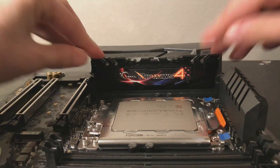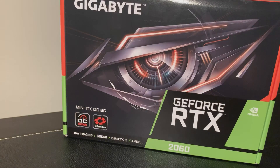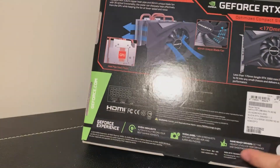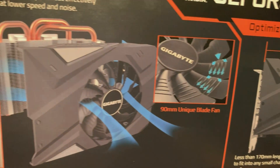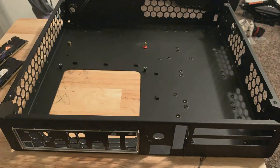As for the rest of the system, we threw in 64GB of G-Skill RAM. With the PSU and radiator covering the front, the GPU is limited to less than 180mm in length, so the Gigabyte RTX mini cards worked perfectly. I chose the RTX 2060 ITX from Gigabyte, but the RTX 2070 from Gigabyte and ASUS will work as well.